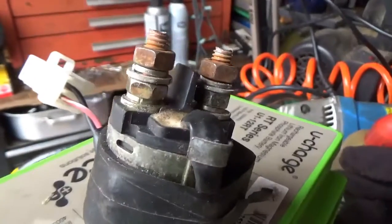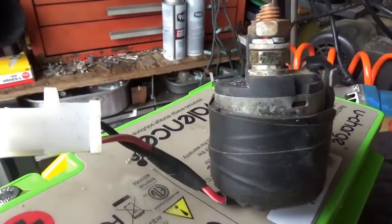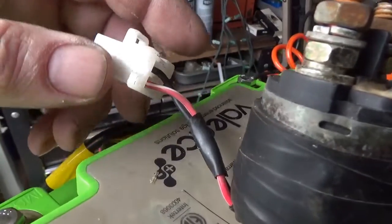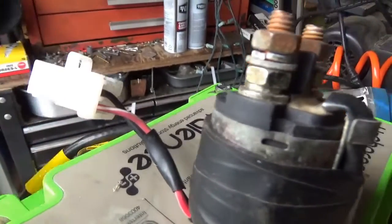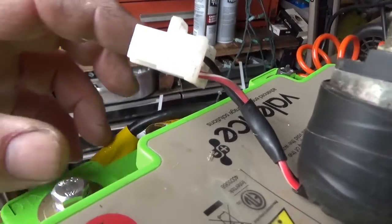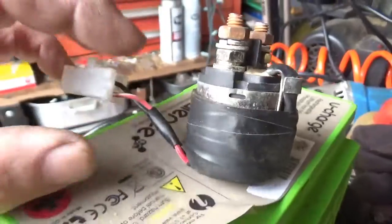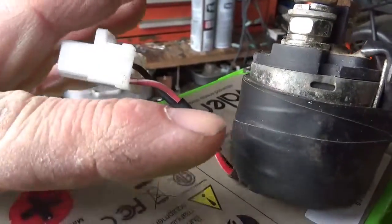The first thing we've got to do is put a couple of wires on this thing for the starter and the battery. On the control side you've got a black wire and a red wire. The black wire has to get to ground, but a lot of times they don't want your starter to engage unless you're in neutral. When you shift into neutral, a little switch inside does two things: that black wire goes to ground, and at the same time it completes the circuit for your neutral light on the dashboard. So it's kind of two circuits in one. The way you make this relay hot is when you push the button you get power there — but your push button won't send power unless your key switch is on.